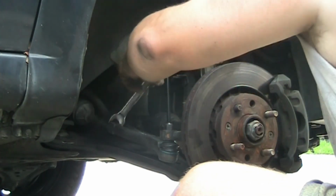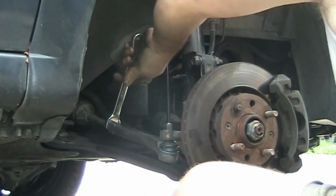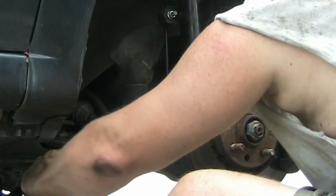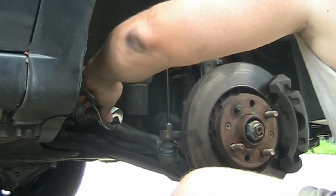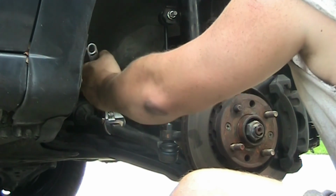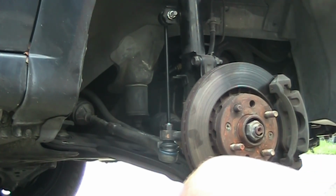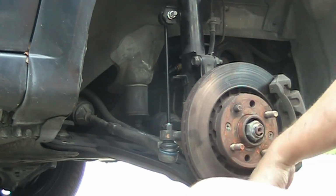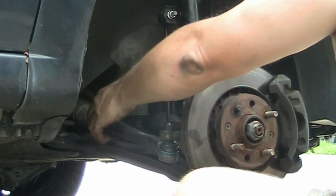That's pretty much getting the tie rod adjusted. Now you just re-tighten down the screw, the nut in the back. And this is bigger, this is 21. Just temporary. Later on, what I can do is I get on the ramp, have these tires sit on turntables, and then I can actually do the alignment quickly and adjust this area here.